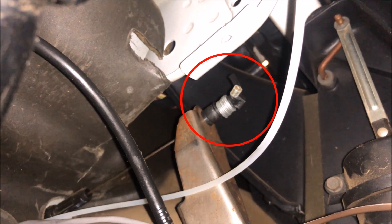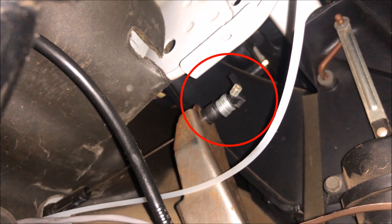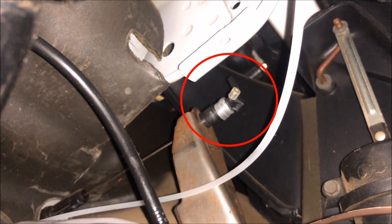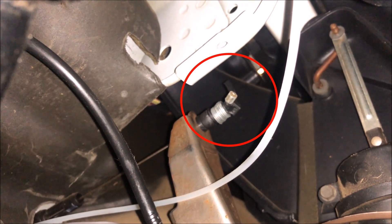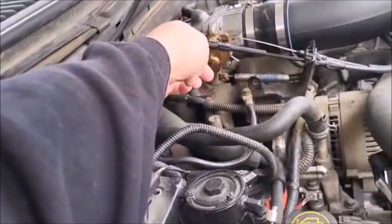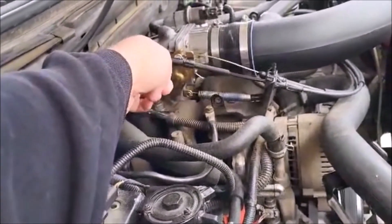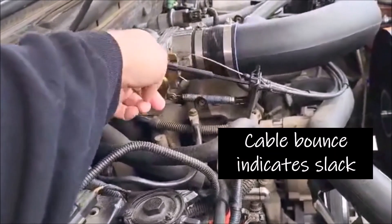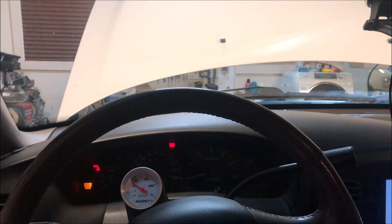You want to get rid of that half-inch of play, but don't over-tighten it — you want a little bit of slack so the throttle blade isn't partially open when you first start the vehicle. You want the throttle blade in its normal relaxed state. Here's an example from a buddy of mine, Mark from Titanic Films by Mark — he sent me this video and you can see the slack in his cable that needs to be taken up using the zip tie method.